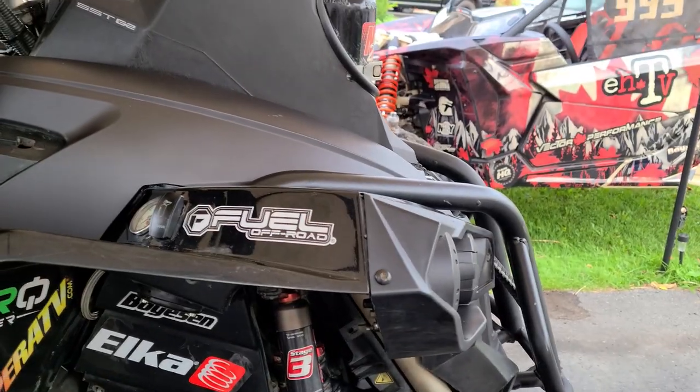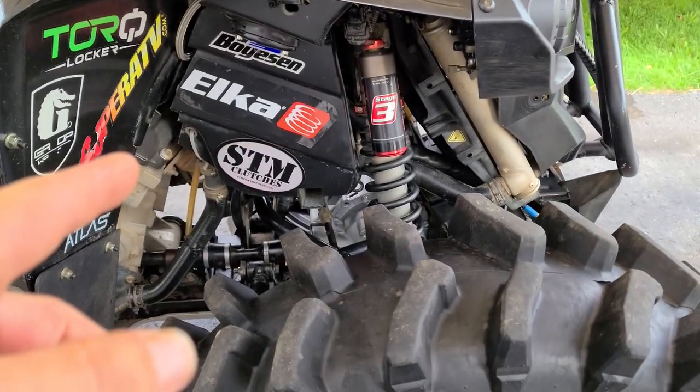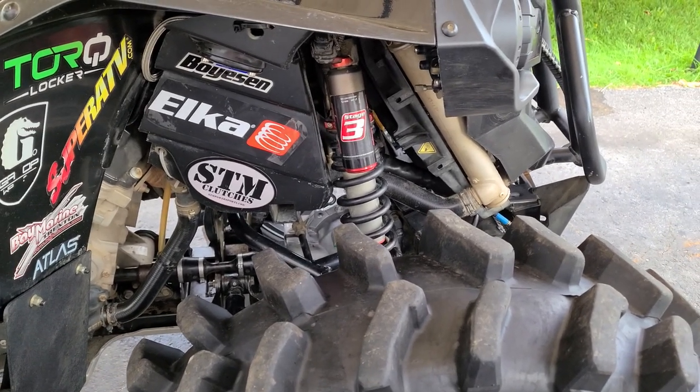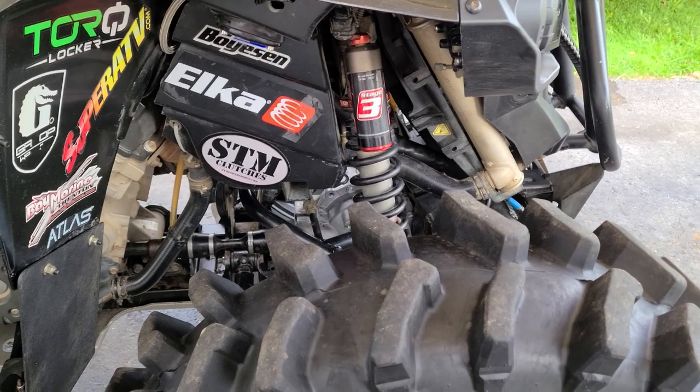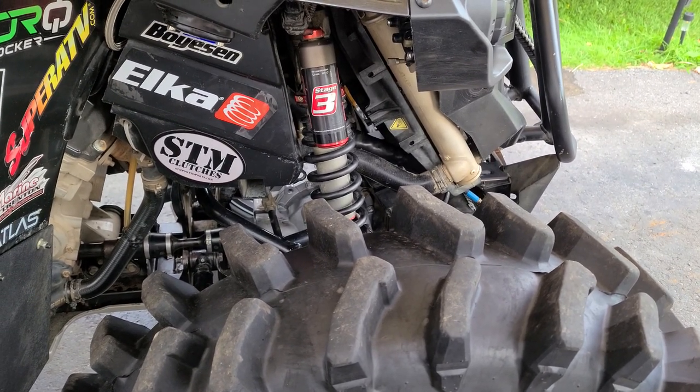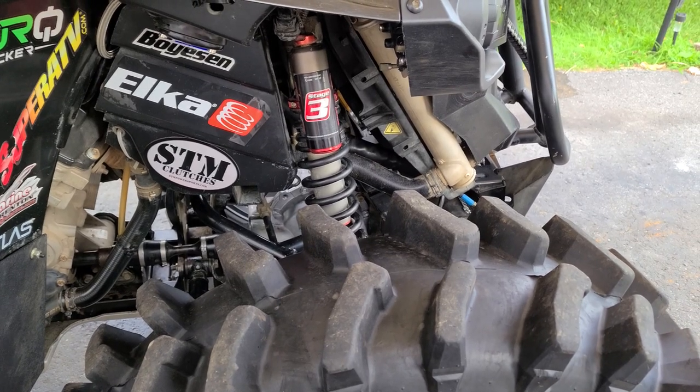I will have to wrap some plastic or something around the end of that harness and elastic it off. It should be fine with some saran wrap or something of that nature, you know what I mean? And pack it full of dielectric grease and wait till I get the switch.